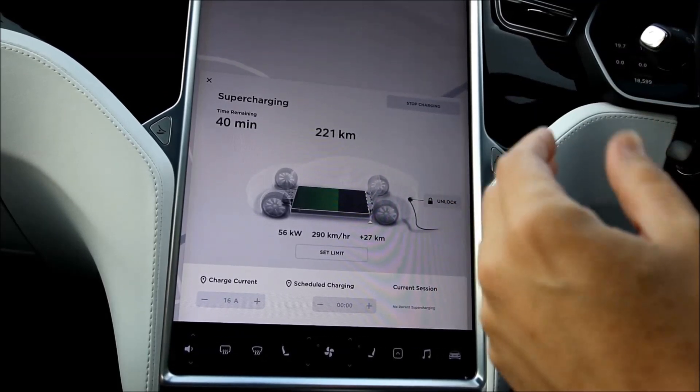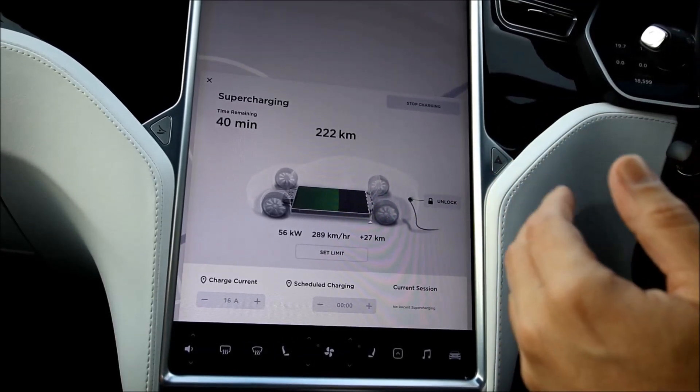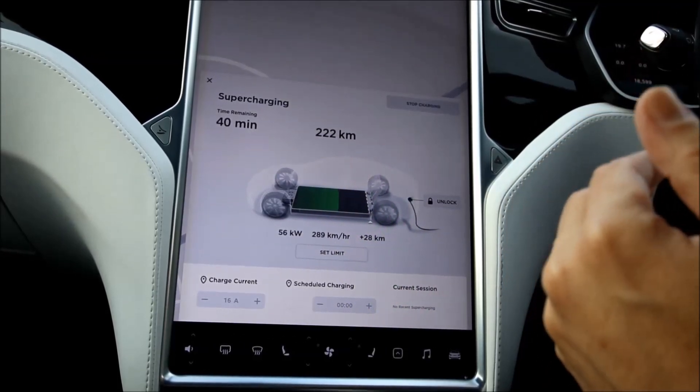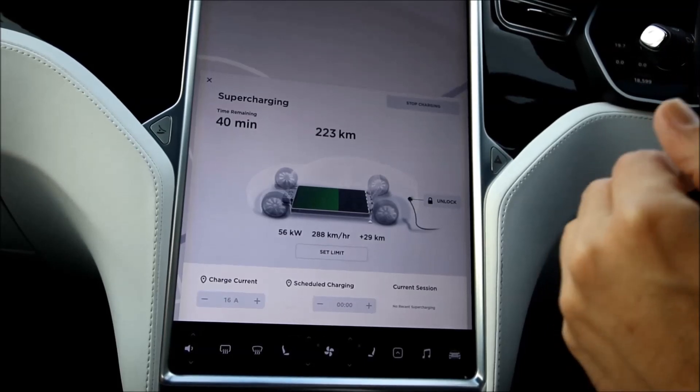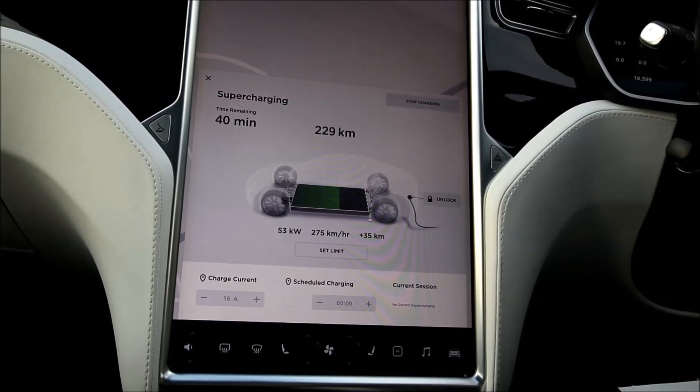This very car could charge at over 100 kilowatts. Note that at Tesla superchargers, some Teslas like the Model 3 Long Range can charge at up to 250 kilowatts. The charging pattern where speed goes down is the same for all EVs: at the beginning of the charge it will ramp up because the voltage is quite low, then peak around 20–30%, and depending on the car it will slow down more or less quickly. This is completely normal and it will keep going down in speed until the battery is almost full.